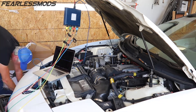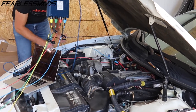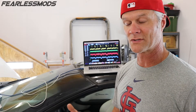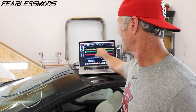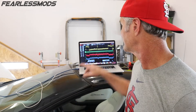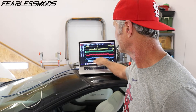Right now I've got all four leads going to the OptiSpark probed and while I'm still not getting an overall nice square wave, I'm still getting the information that verifies that I am seeing all of those slots. It is interesting how these interplay — even the low res signal is getting impacted once every degree, and conversely all the other signals are getting influenced by my low res signal from the larger slots, because every time I have one of these it fluctuates the other ones as well.